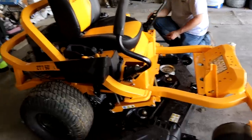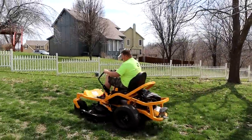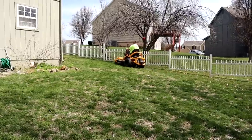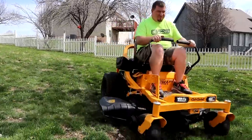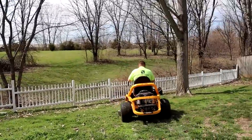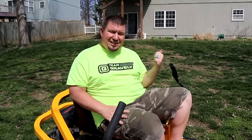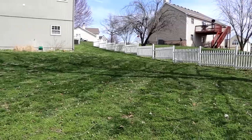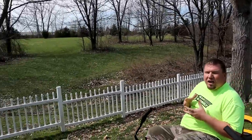I just wanted to record this quickly. I'm cutting Randy's backyard — it's real uneven with a lot of choppy little areas, so it's not ideal to demonstrate cut quality. I'm just trying to see how bad this deck is vibrating. Most mowers, when you want to engage your PTO, you want to be at full throttle — don't have it at low throttle and then go full force. I noticed that when you start them at a lower throttle they get out of sync. As long as I was cutting grass, the vibration wasn't nearly as bad as it was in the garage. It's definitely mowing, cutting, and doing a decent job at striping for a residential machine.